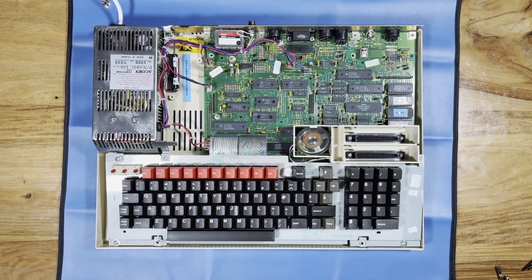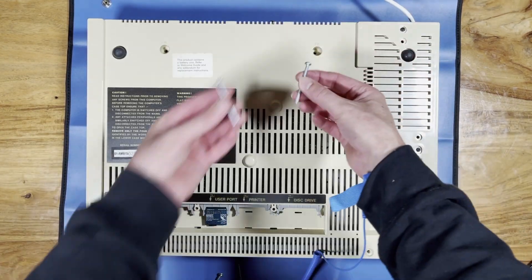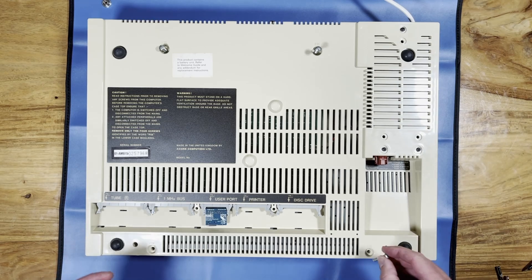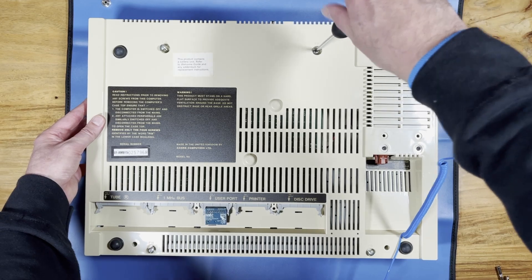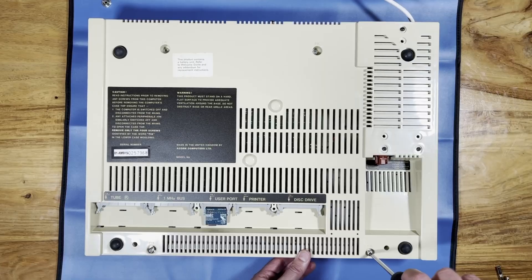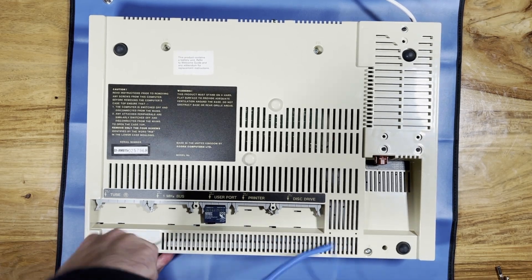Knowing that the ROMs worked okay it was now just a case of putting the machine back together. Just a case of getting the top cover back on, then flipping the machine over and getting those four screws fitted — don't forget the long screws go at the back and the short screws go at the front. A tip from Mark Fix's videos: always turn the screw backwards before you tighten it up. Get a reverse turn on it, feel it click and find the groove, then screw it in as normal. With older machines you don't want to be cutting new threads in the plastic as over time that will render the screws useless.